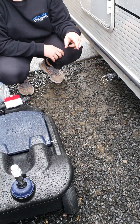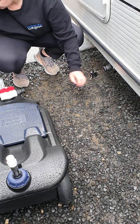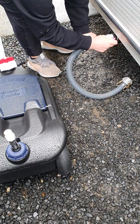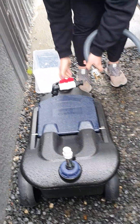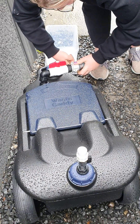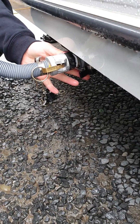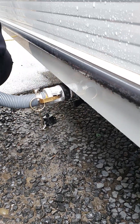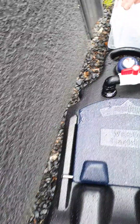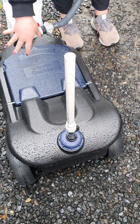Just up on the same side as your housing unit but behind your wheel, this is the outlet for your grey water. To connect this, take that cap off and your grey water hose pops on — these cam locks can be a bit stiff when they're new. You've then got the same connection on your grey water caddy. There is a valve underneath, so once your grey water hose is hooked up, make sure that is in the open position. Make sure this valve is open as well. There is a little gauge up the top so you can monitor when you need to empty it.